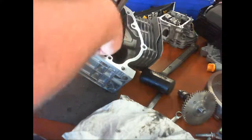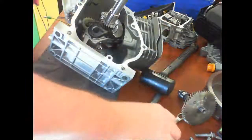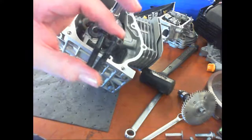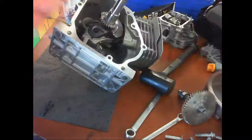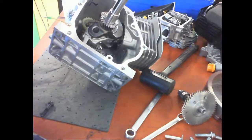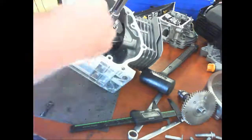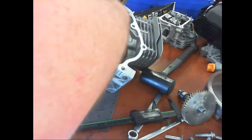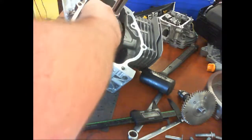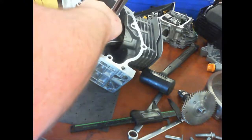All right, some assembly lube. Install, there we go. All right, so now we have the two bolts for that. They're also 6mm. These are the easiest ones to spot in your tray. They're the only ones that are black. So they're 6mm by 32. Okay. So I'm just getting one in, got it through a couple of turns, and then I put the other one in.